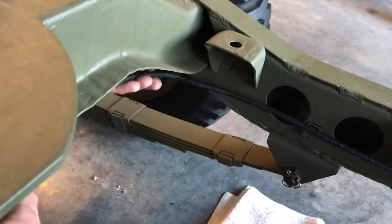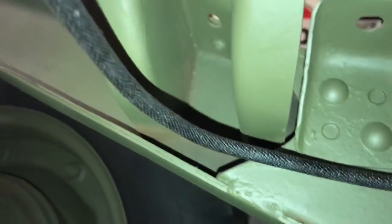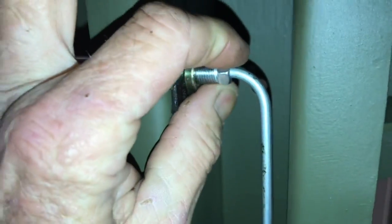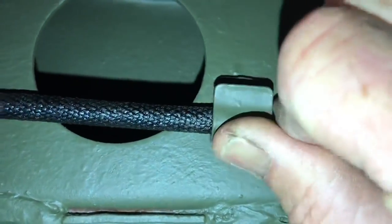Let's go to the rear of the Jeep and install the rear brake line to the flex hose. That bend shown earlier on the bench fits right up inside the crossover tube where the machine gun mount is. You may have to do a little adjusting to get the fitting to go correctly into the fitting on the flexible rubber line. Note the small hole in the crossmember — you want to run that brake line up against the back side and then toward the front, and that bend will fit into the fitting on the rubber hose. Once everything is lined up, finger-tighten the fitting. Then trace the line back down to the outside of the frame rail. Go ahead and use the clip on the side of the frame rail to secure the line — make sure it clips into the bottom side of the clip and is fully secure.